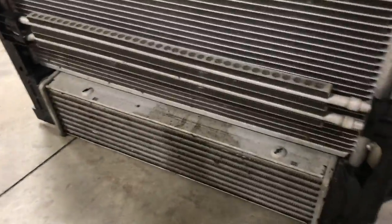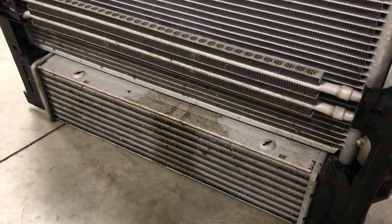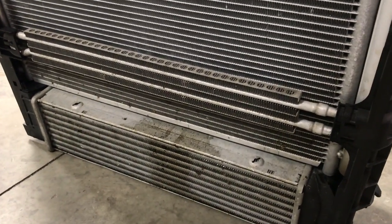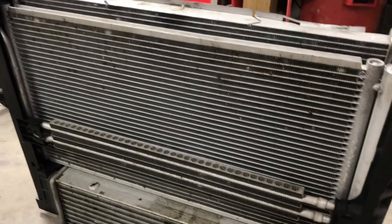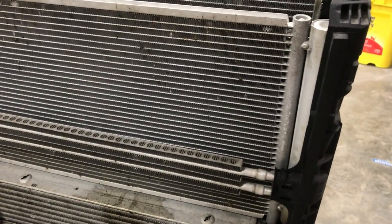The intercooler will be upgraded. It will have a much longer front end, which will peek into the front bumper a little bit, but we should have enough clearance for that. This should be relatively simple — we're just going to take the stock E36 radiator mounts and adapt them to this radiator core.